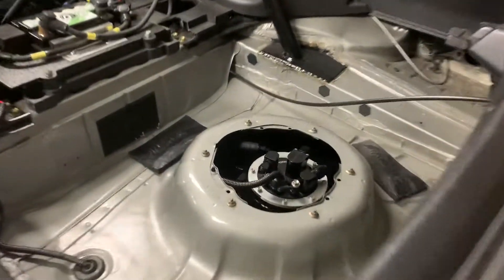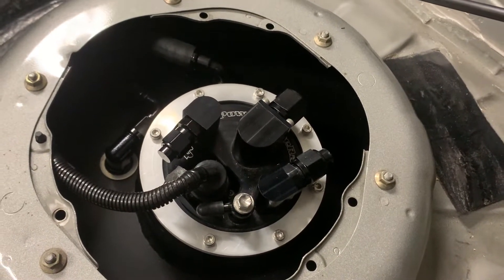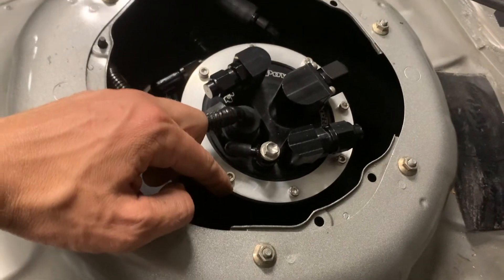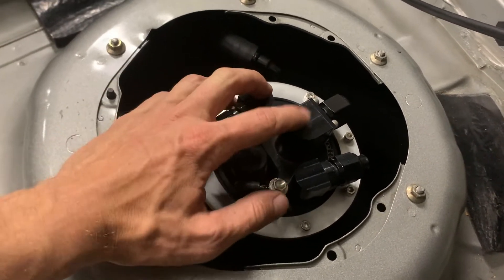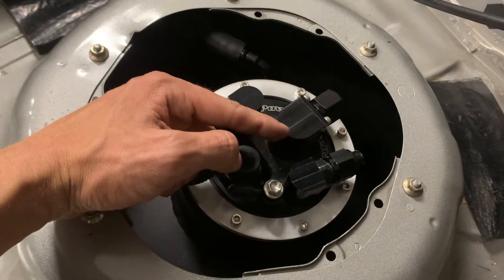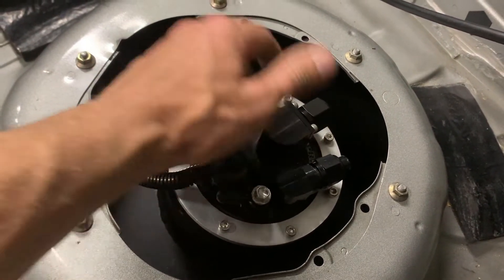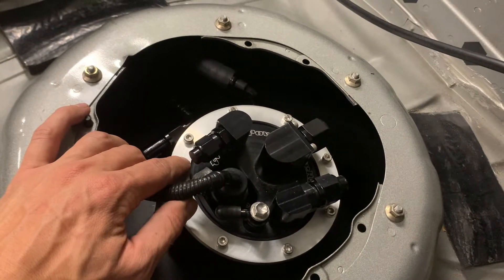I'm trying to wrap up what I can, but I came to the realization that I'm going to try not running the priming pump that's under here. The reason for that is, when the mechanical pump is pulling fuel from this tank from the bottom, it's also going to be pulling it from here, which I don't want — I only want it to pull from the bottom. So in order to use this as a primer pump, I actually have to block off the bottom of this hanger where it used to pick up fuel, and it's not very simple to do. So what I'm going to try first is just no priming pump, just a mechanical pump only, and see how it does. I'm sure the first start is going to be terrible, but I think with a check valve it should hold most of its fuel and start up fairly decent.